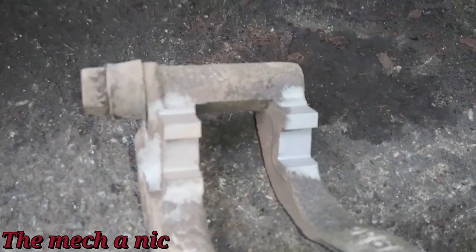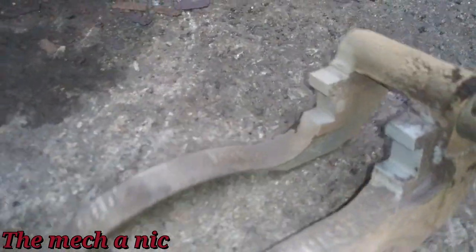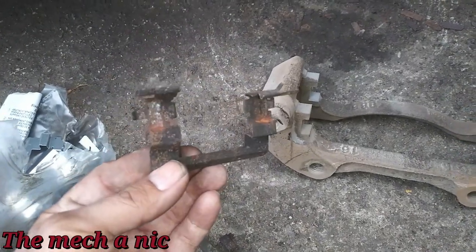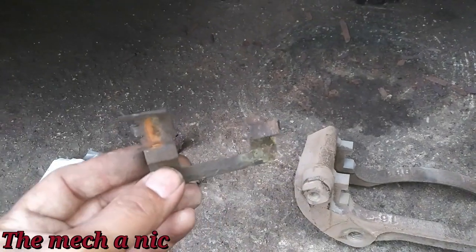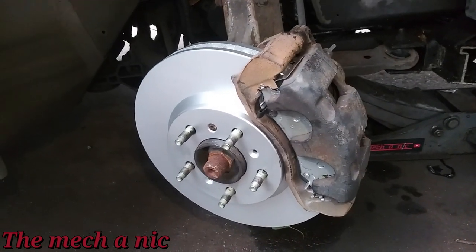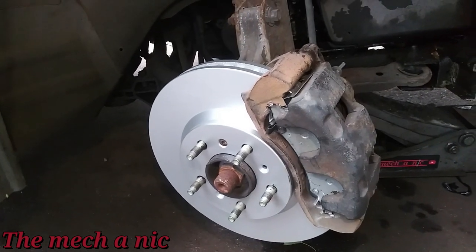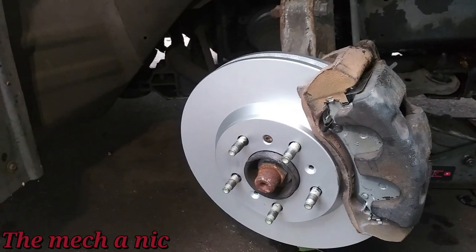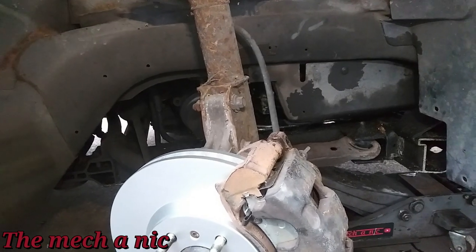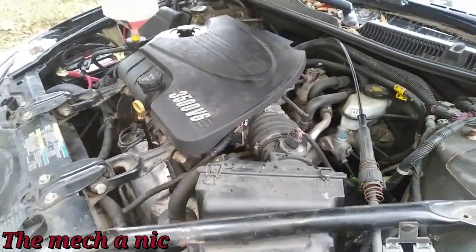I chucked the bracket in the sandblaster — you can see we cleaned off the face where the pads are going to ride, nice and clean. Make sure to get pads that come with a new hardware kit. New pads, new coated rotors — this is why it's important to get a good set of pads or at least buy the hardware kit separate. Look at the condition of these — this one's even missing a chunk right there, so it's not usable. I'm all done with the brakes on this side. Now I'm going to pressurize the cooling system again and keep a close eye on it, maybe get in there with a mirror to see if I can see that water pump dripping.